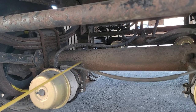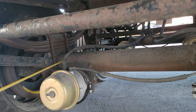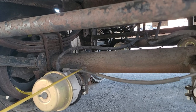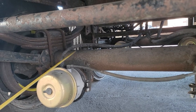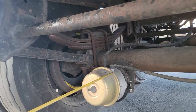Our brake hoses are tied secure to my double brake chamber. They're not loose — they're tied secure. They don't have any cuts, no bubbles, no leaks. Keep in mind, they don't have any leaks because they either have fluid or they have air inside — so your hydraulic and your air systems. No leaks, good condition.